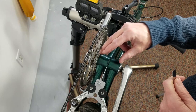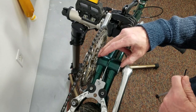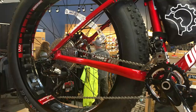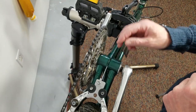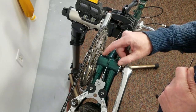Typical bottom brackets, 68 to 72 millimeters is the standard — that's basically one size. They also have 100 millimeters and then 120. Those 100 and 120s are for fat tire bikes — that's what those are usually used for. This is an older style bike, 68 millimeters on the dot. You can get the same mid-drive unit that will fit from 68 to 72.